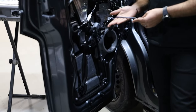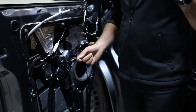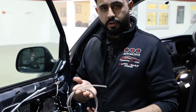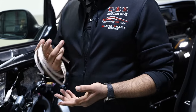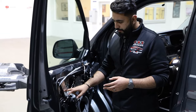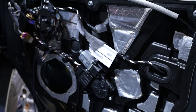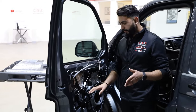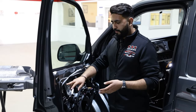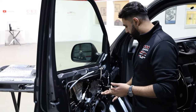This weather shield protects all the electronic components — like the window modules and cables — mounted on this side of the connector, except for the actual terminal on your speaker. What we've done is run cables through to the back of the speaker using connections-grade cabling for the components in the door. We've got oxygen-free cabling for the sub because we're sending a lot more power there. We've acoustically soundproofed key areas inside the door card, but still retained factory grommets and access points in keeping with manufacturer design.